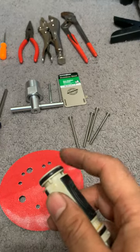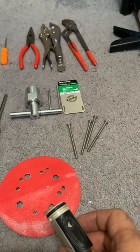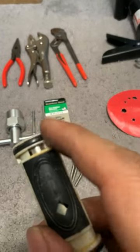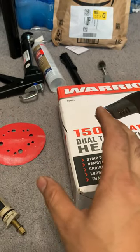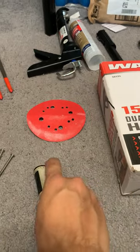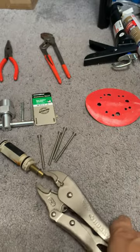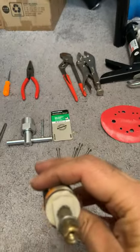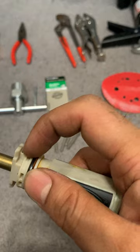It kept removing material slightly and I tried again — it still wouldn't fit. I took it out and kept rubbing for a while. After removing some material around it, I used the heat gun, put the mouth inside the valve, and heated it about two to three minutes. After heating, I brushed the edge, inserted the cartridge in, and gave it a gentle tap around. Then the new cartridge was able to go all the way in. Otherwise the pin was not able to go around it — there would be a gap and I wouldn't be able to put the pin.